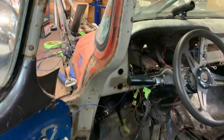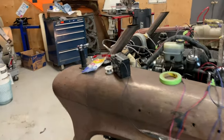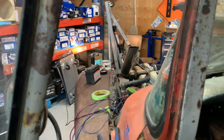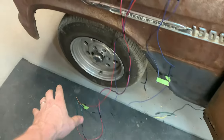So when I hit the switch, something should happen. Not a lot. I'm sure that little tiny battery isn't liking probably 15 amps from those headlights, but I have power on both circuits. So that means my headlight circuit is good. My grounds I'll probably clean up, but I will be running grounds to every piece of sheet metal on this truck anyway, because I hate chasing electrical issues. But either way, I don't know if it got brighter or not, but whatever. I know everything here works.